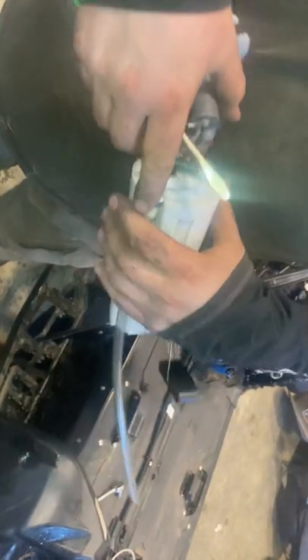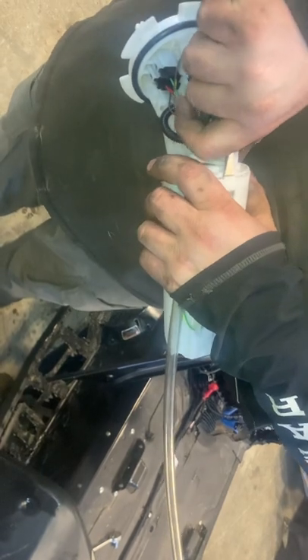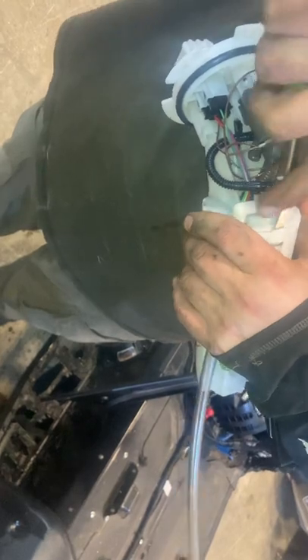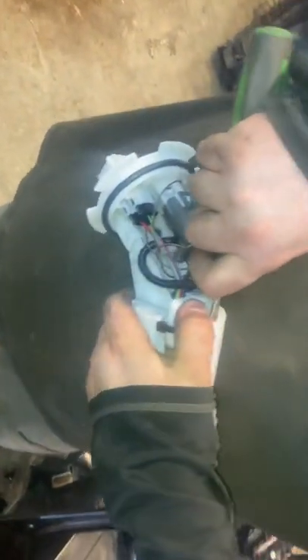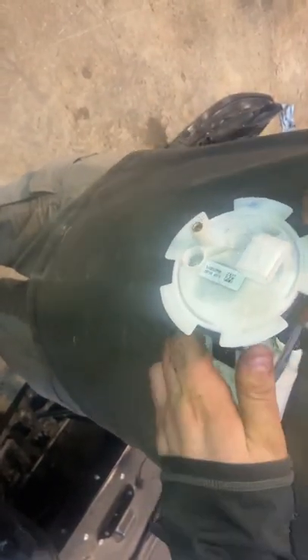The 900 Ace — actually pretty much all the fuel pumps on these new machines — they've got three tabs: one, two, and three. To get them apart, you just ever so slightly put your screwdriver in there, get a little bit of a gap, and then move to the next one. You don't want to horse these things — these are expensive. Don't know if you can even buy this part separately, so don't break them.